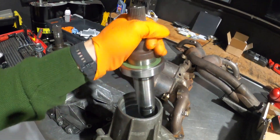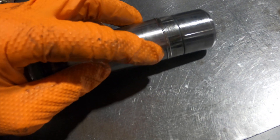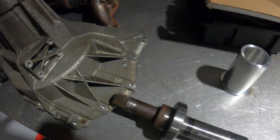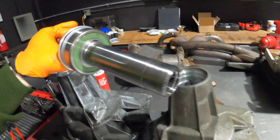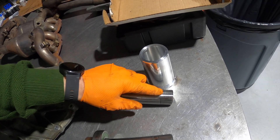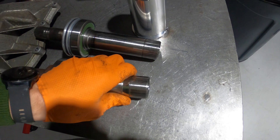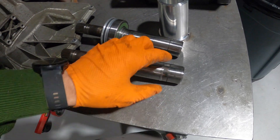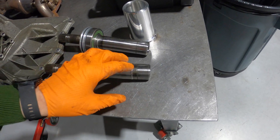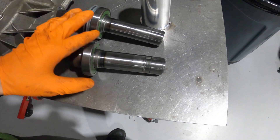This is the nose cone of the FF — you can see at the end there are little ridges and some loose metal. You can pick at it. That is not normal. Here is the GTC4 Lusso, and you can see it's nice and clean with a slight lip and a nice even bearing wear pattern — the little shiny path. On the FF it creeped up enough that this started to wobble, the bearing locked onto the shaft and was spinning in the case, causing movement that's placed directly on the front of the clutch, which can cause serious issues.